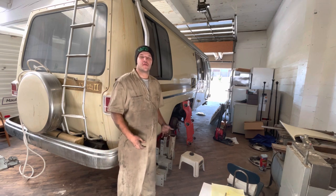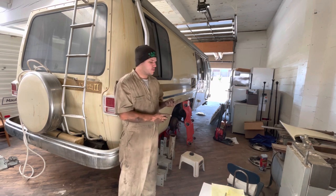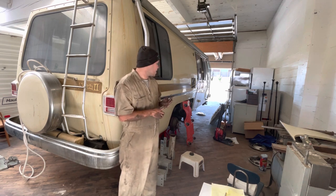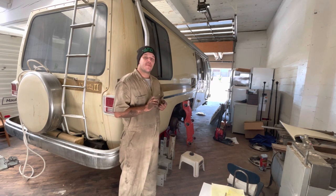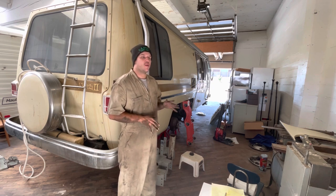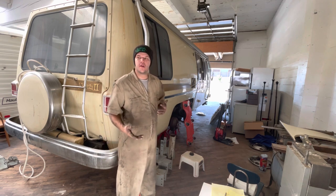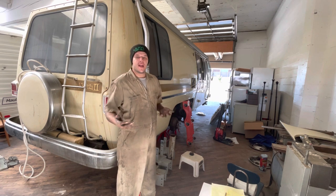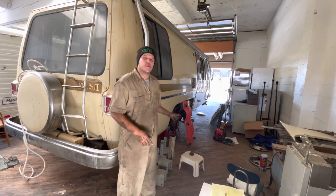And the best part about this job is between the new elbows, the new fuel hoses, the new sender O-rings, and if you need senders, that's a little more, but I'd say without the senders, even with painting the tanks, you're looking at under $150. If you need the senders, you're looking at around $500, and the labor isn't really that bad. I'm gonna have probably 6 to 8 hours wrapped up in this by the end of it after I paint everything and run the new hoses up to the engine.